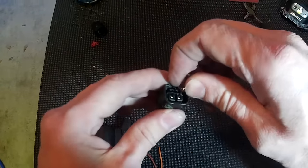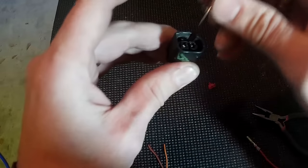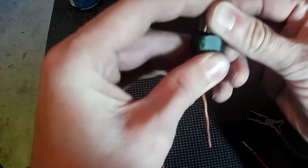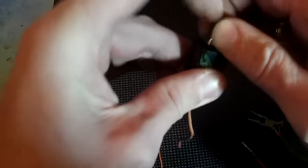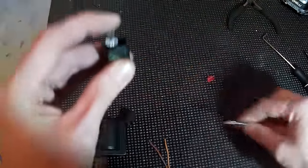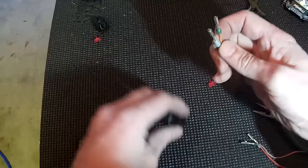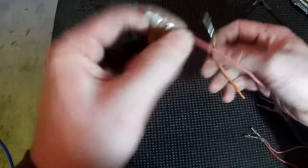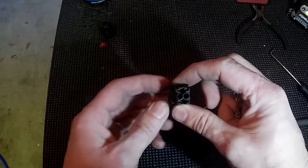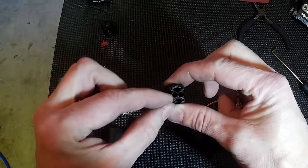Now I just want to come in. This is my junkyard part, so pull the wiring pin out. I already did this earlier today and I put my old harness back together to show you how it was done. I did this right in the engine compartment, and it was very simple. If these wires are still installed in my vehicle, the most important thing you need to remember is your thicker wire. In this case it's my red one. This thicker wire goes — if you're looking straight down at the harness and the tab is on top — your thicker wire is on the left-hand side.